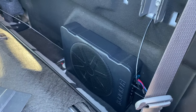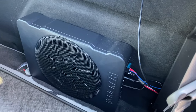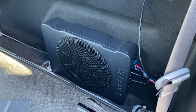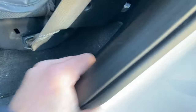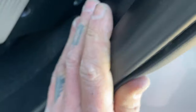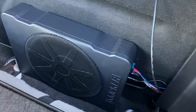I want to do a short video on how to install this Kicker self-powered hideaway sub in a 2015 through 2020 F-150. First things first, I didn't have the WPT12 connector that would typically be down in between there — it'll be down there on a white clip, just an open connector. My truck didn't have that, so we had to go a different route with it.